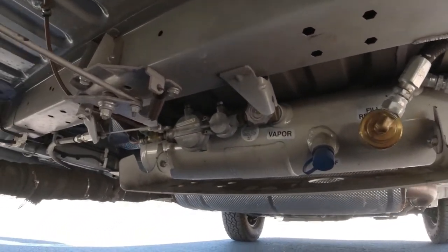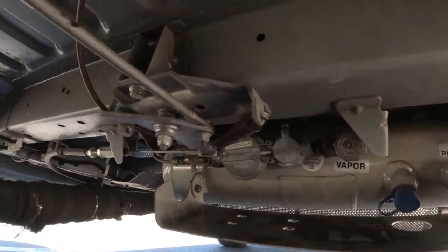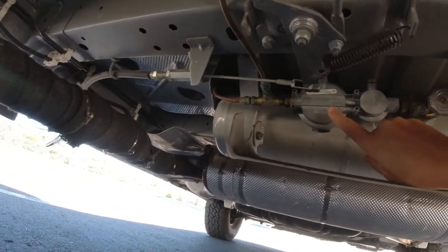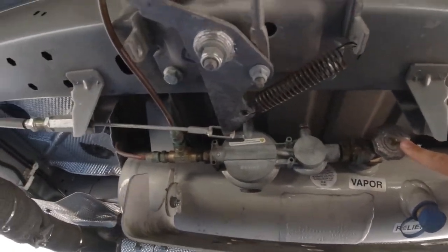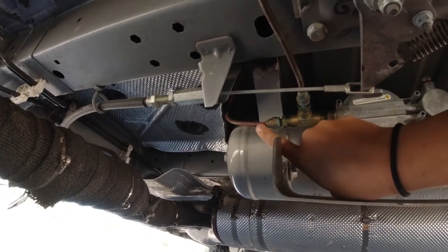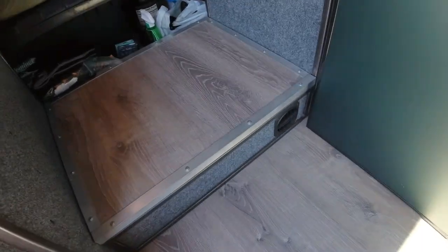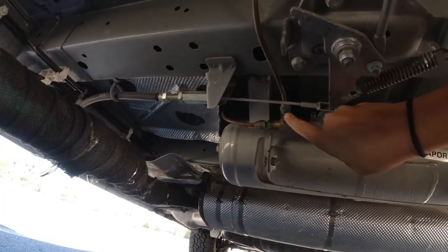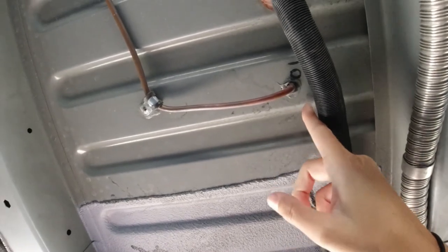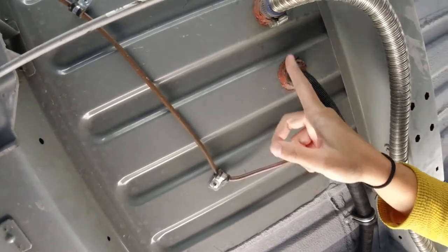Now I'll show you guys how our propane lines are run off of the propane tank. This propane tank comes with a regulator — it's extra, but they sell you the regulator that goes with it. So we've got a two-stage regulator, then a manual shutoff valve. We have an out for our propane and we put it into a T-fitting: one copper pipe goes to our cooktop and one goes to our heater. Our heater is in the center of the floor, and you've got a flared fitting that goes into a quarter-inch copper pipe. This copper tubing goes up into the floor right here, and these are actually our exhaust and intake tubes for the heater itself.